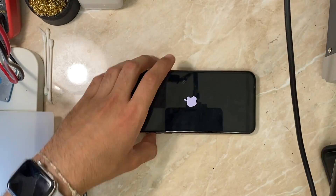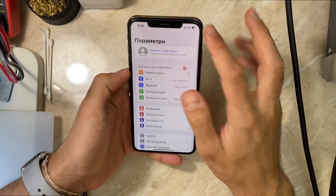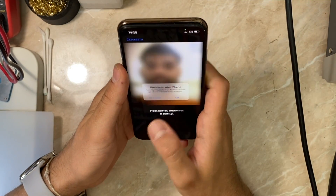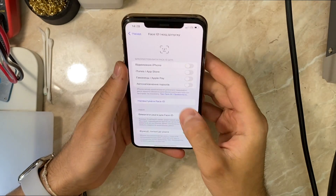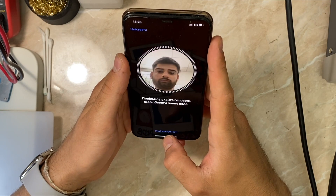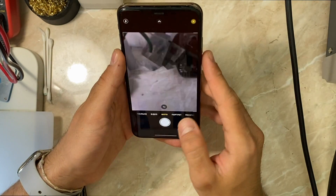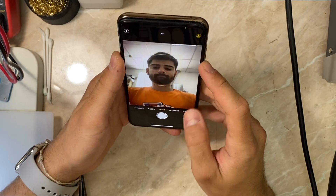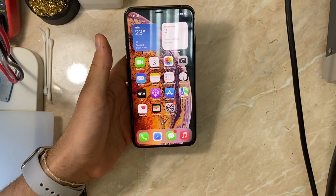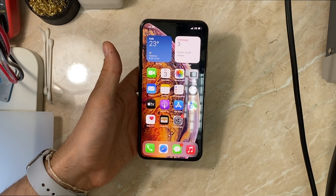I hope I explained everything in this repair. This video covers almost full diagnostics for a non-working front camera, except for checking the output voltages of the camera IC — but it's very rare to have a problem with the camera IC itself. For the final test, the front camera is working and Face ID is working. If your Face ID doesn't work after restoring, just restore or update with all Face ID components connected. The main camera and front camera are both working — that's it for this video. Thanks for watching, leave a like, subscribe, stay safe, and have a good day. Peace out.